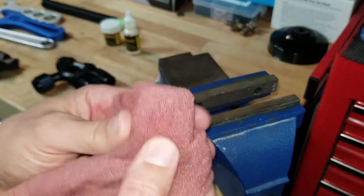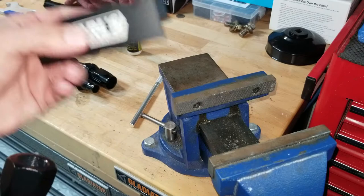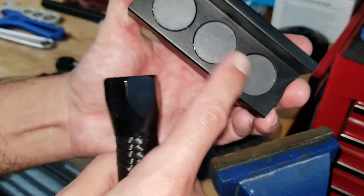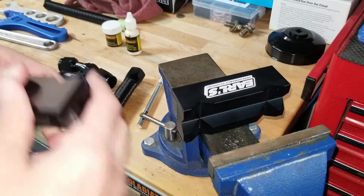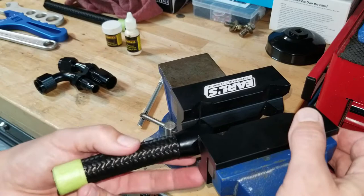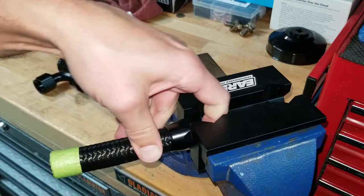What will help here is to use a vice. Don't just stick the fitting in with steel jaws because they'll scratch the aluminum and it will look horrible. You're going to have to get creative — either use a shop rag and wrap it, or buy inserts for your vice. Check this out — this is by Earl's. Earl's is a popular brand name for AN fittings. It has magnets on it so it sticks right in there. You can put it in different orientations. We have the mating side, and we can just push this in all the way until it stops. Done — just like that.